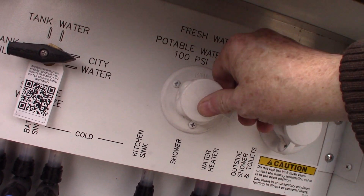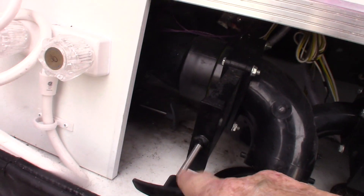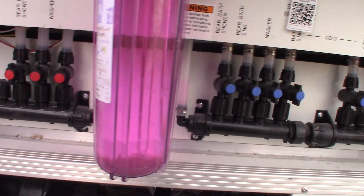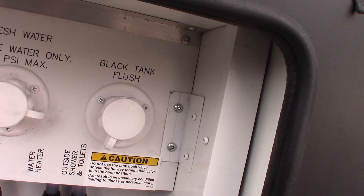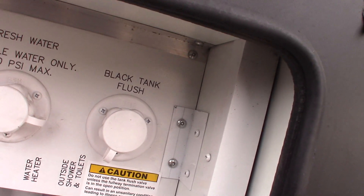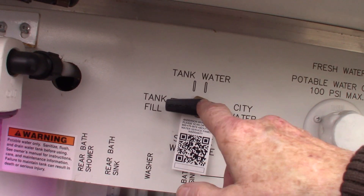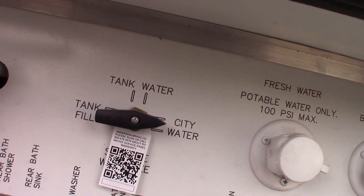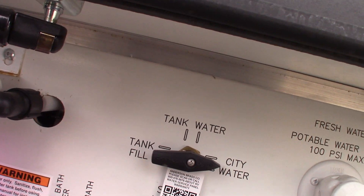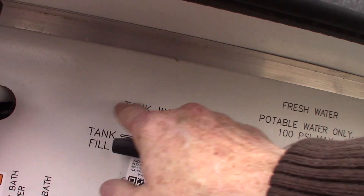This is a city water hookup right here. This is the black tank flush. The idea is: after you dump the black tank — which is always the large valve, much bigger than the gray valve — you dump it and then leave it in the open position. While it's open, you hook the hose at the dump station onto here and turn it on. It'll spray out the inside of the black tank and clean off the sensors so you get a good accurate reading. As the sticker says, always make sure the valve is open before you turn on the water. This is just a simple selector — you can go from city water, which is the most common, by just hooking the hose up here. You can flip it over to fill the tank, and if you're camping somewhere without city water hookups you can fill your fresh water tank and pump the water right out of the tank.